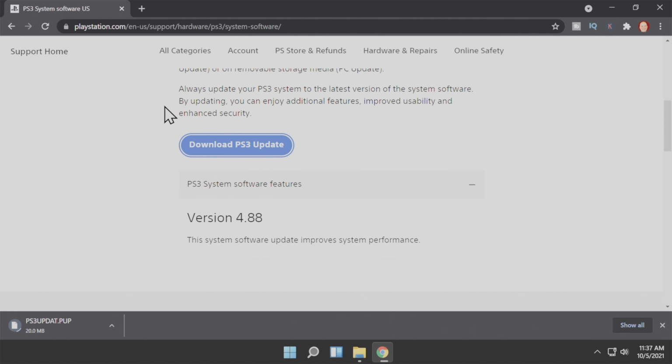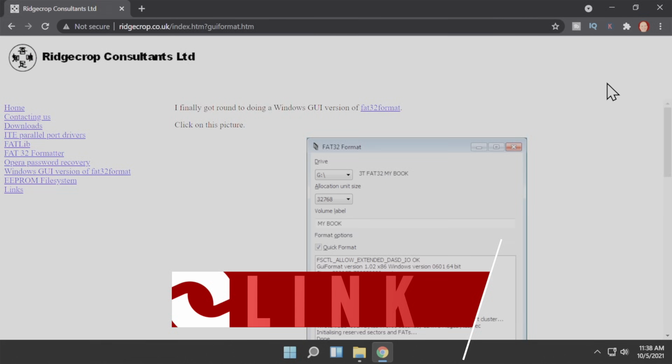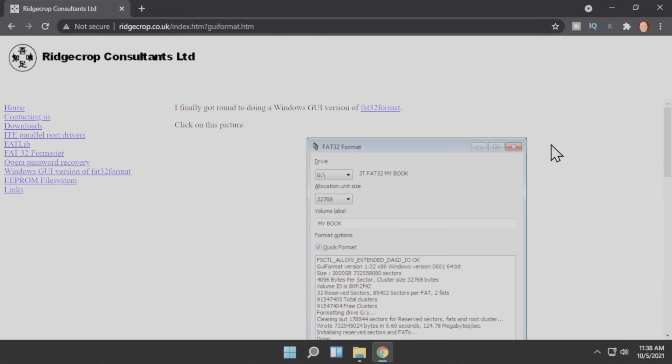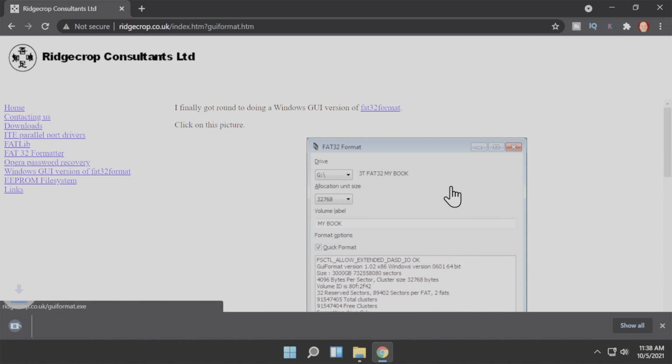If you're going to use a USB drive larger than 32 GB, download the GUIFormat software linked in the description below. This makes it possible for Windows to format volumes larger than the 32 GB in FAT32.